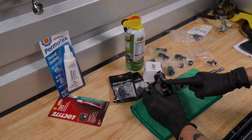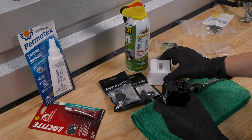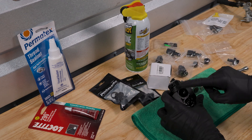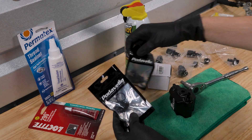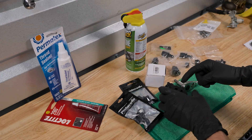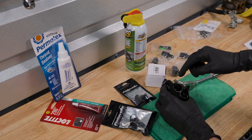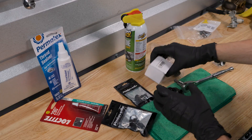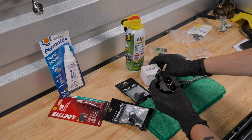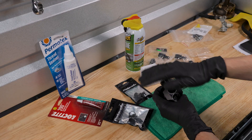Because I didn't read the directions, I'm going to have to go ahead and remove this MPT bung. So if you are installing a radium fuel pressure gauge like I am, you will be utilizing this top bung for that reason. That is why I purchased these two fittings on Amazon specifically for this. This fitting screws into this port, and then there's a 90 degree elbow adapter that gets installed and threaded into that port as well. That is where the radium fuel pressure gauge goes. For those of you that aren't installing the gauge, you guys can leave this in and keep going to the next step.